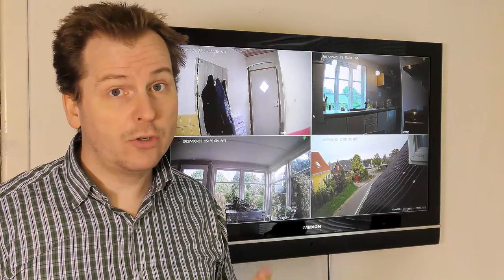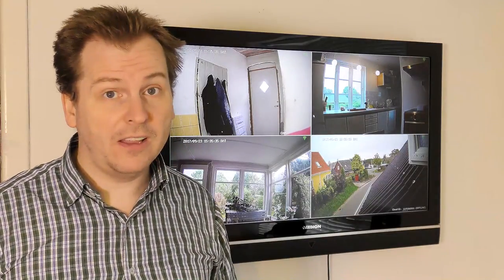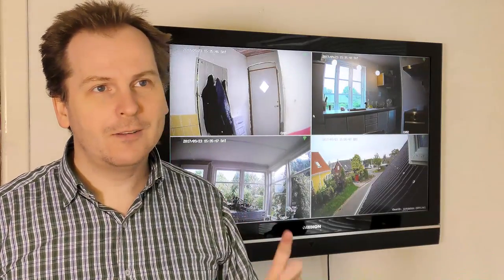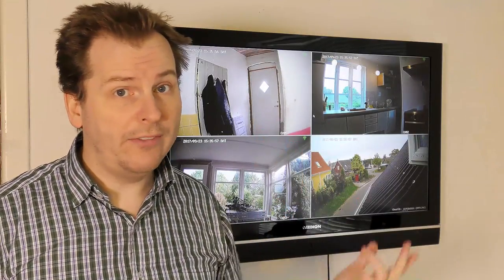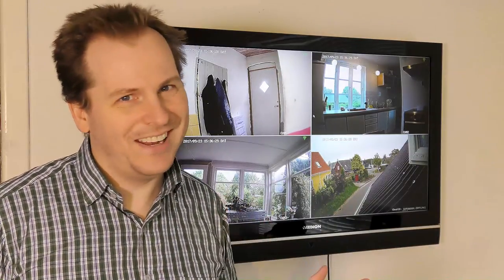But I was amazed how easy this was to set up. I thought that I would have to go in and configure each camera and tell it this and tell it that. I didn't have to do anything, it just popped up. Which is both good. It's really good when you're doing a video review. You probably need to go in and set some password and some stuff on those cameras because they are probably widely available through the Wi-Fi. The neighbor could go in and see my camera and see what I'm getting for breakfast. Don't really want that. So there is the option of logging into the camera and setting the passwords for each camera so that the system will need to use a password to get into that camera. So you have to set up security on your security, more or less.